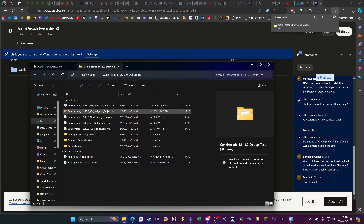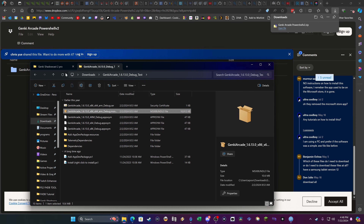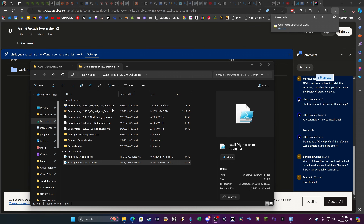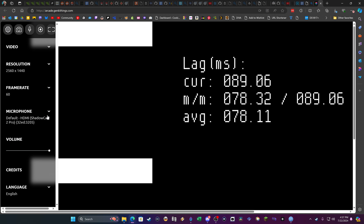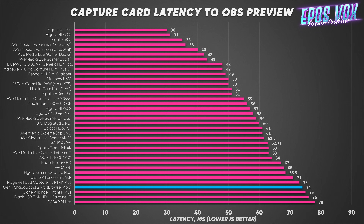Genki also offers a dedicated app to play and capture from, which should theoretically be the lowest latency option. However, on Windows they now only provide a bunch of dev files and a PowerShell install script that I couldn't even get working, with people in the comments asking why they can't install it. It's a super bizarre approach and they just need to release a normal installer package ASAP. Testing the browser-based Genki Arcade tool results in 74-75ms of input latency in both 4K 60 compressed and 1440p 60 uncompressed modes. Testing their iPad app, input latency was around 82ms in any format, so not great here either. None of these I would recommend for playing anything but slow or turn-based games.